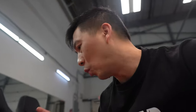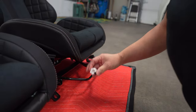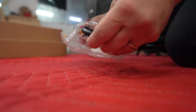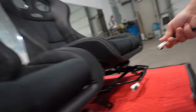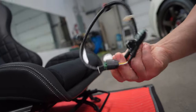It's taking me a little longer because we ended up needing an extra wire harness. The one that comes with the donor car comes with either heated seats or power seats, and the plug doesn't fit. I double-checked the Civic Type R — the plug is a little smaller — so we end up getting a new harness from Honda. So if you guys are doing the conversion, you will need this harness with this plug here. See how it's much smaller? And this goes into the seat position sensor underneath — it should plug right in.